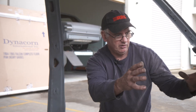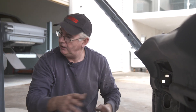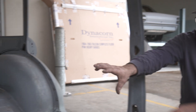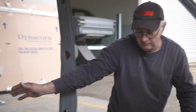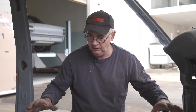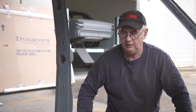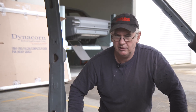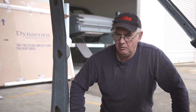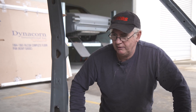It's primarily got weight and all of its suspension load in the bulkhead — that's the main structure — and then at the rear its main weight is in the structure of the rear rails, where the suspension and driving forces come from. The bit in between is the main part that has a series of twisting and beaming aspects. The things that cause this are high-powered engines, inadequate gauge of steel, badly done repairs from accidents or rust. There are all sorts of reasons why a car ends up being a really floppy car.